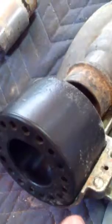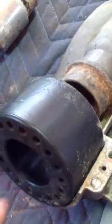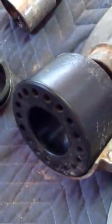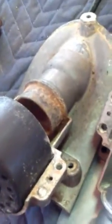Even underneath where the old adhesive was, you can see all the corrosion. The water just flows right through that corrosion and goes right out the edges. So I probably was getting water in from there too. But for the most part, when I was looking in there, when it was in the water, your coupler would be right here. You can see, I mean, water was pouring in, just squirting in from the front and the back. I could see water was coming out of the back. So I had a pretty good idea that the bearings were shot on this. But if you're going to do it, do the whole thing. Take this plate off, clean it up.